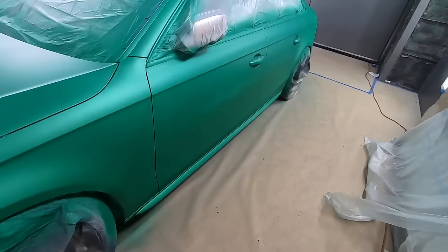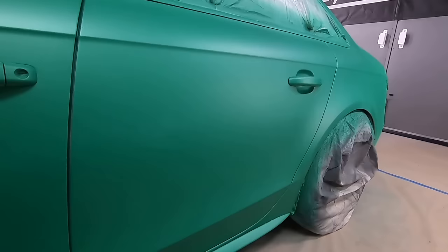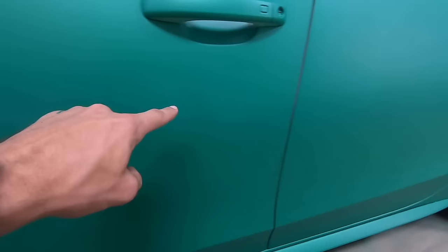All right, so your first color coat is dry. Now, all in all, we did pretty good, but let's take a look at some areas where we can improve and make some adjustments. Now, this entire side came out good. We've got this one section right here in the middle, if you see it, where you can still see that gray. You see that? Mm-hmm. That's an area where you missed your overlap. So you came through here, and instead of getting that overlap, you dropped it down a little too low. So we'll keep an eye on our overlaps. Other than that, this side looks good.